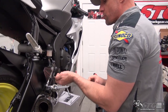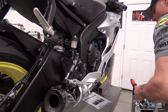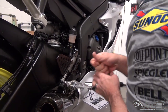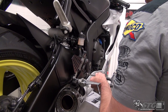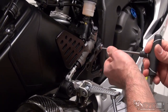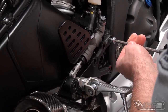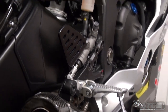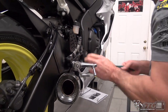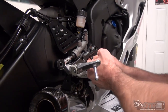Always save all your OEM hardware and make sure you save your OEM rear sets for spares in case you have a crash or issues down the road. The TT rear sets offer adjustable foot pegs as well as an adjustable toe piece. There are just four holes to choose from and you're able to move the foot peg itself around. He has indicator marks etched on the rear set that show you how far up, how far back, and the OE position — so you have a good idea of where you're setting them and it takes a lot of the guesswork out.